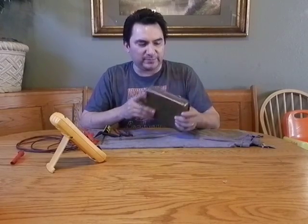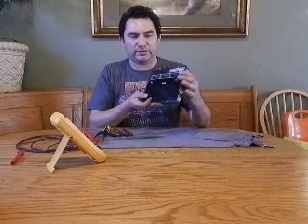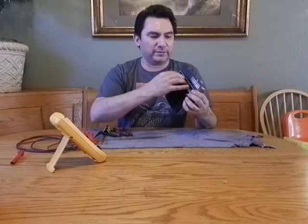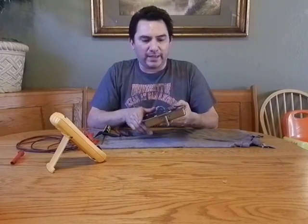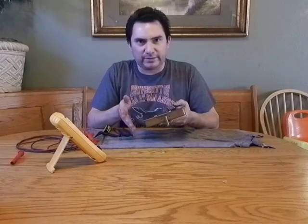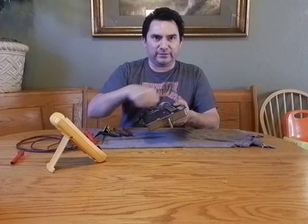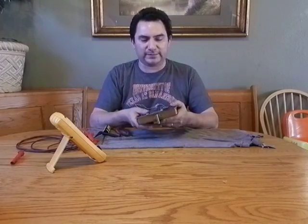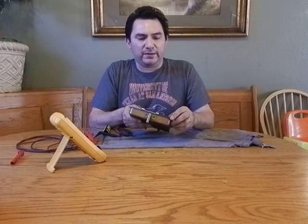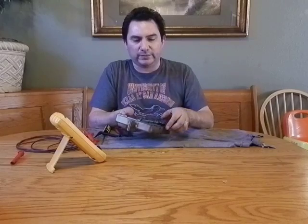It's a pretty solid PCM — you can see this is the PCM out of a Grand Cherokee. It has three connectors that go inside of here. As the connectors go in there, they pull down on this header right here and that tends to cause some problems. Another repair that's been out there is to put a zip tie inside of there and kind of move the wiring a little bit to take some stress off, and that also helps, but that's not the issue either. Bottom line is you're trying to find the root cause of what's really going on.